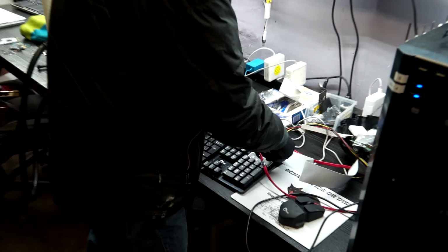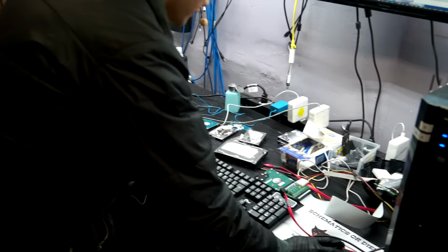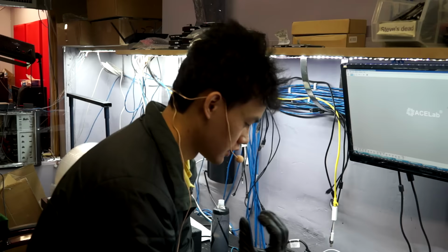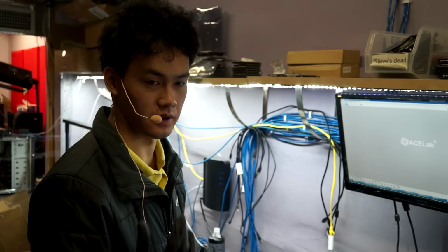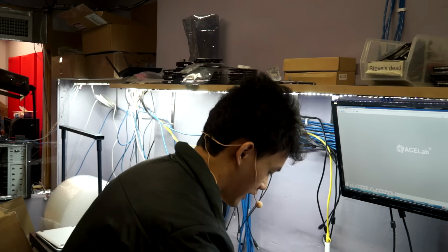What actually happens here is, with these older Toshiba drives, they've got fluid dynamic bearings in them, so as they age, the fluid gunks up, and it becomes very thick and crusty. When it becomes thick and crusty, the bearing and the spindle won't turn, and therefore the platters won't spin, and it'll jump around like it did there, and it will make very nasty sounds.